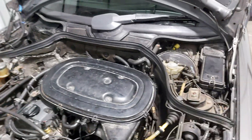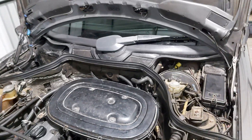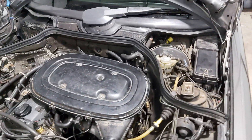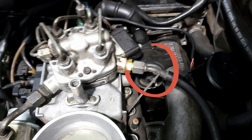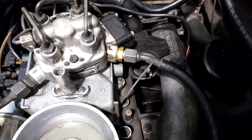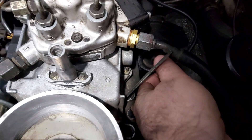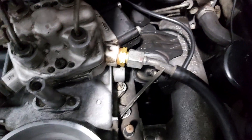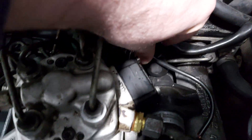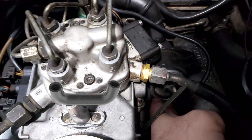Now I'm going to show you where to find your ICV. Looking from your left fender, the big round-shaped thing in its rubber housing — that's your ICV. To remove it, just unplug its connector, the breather hose, and one more C-shaped rubber hose that connects the airflow meter housing with the ICV.